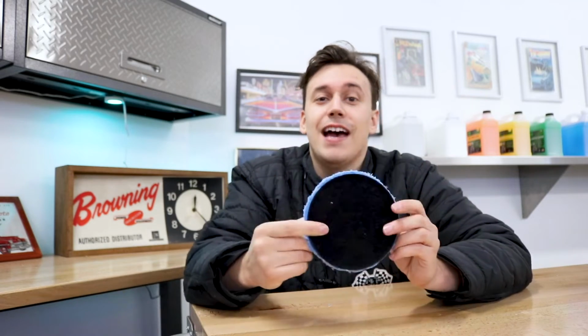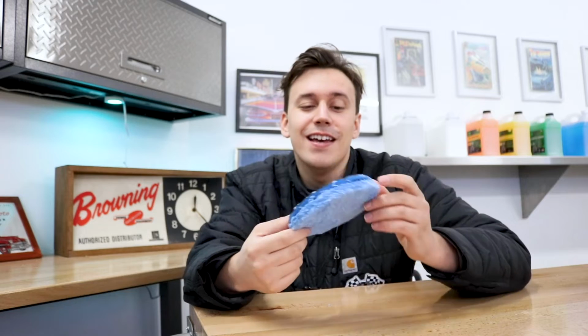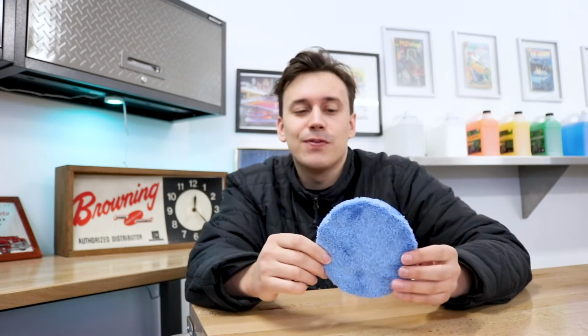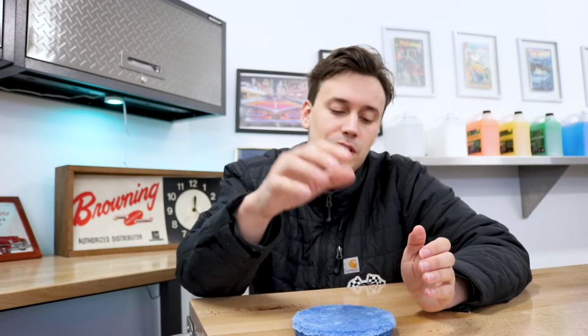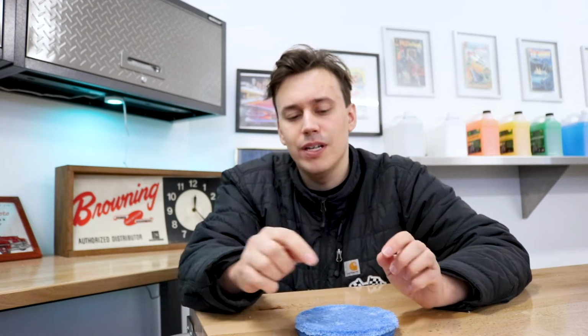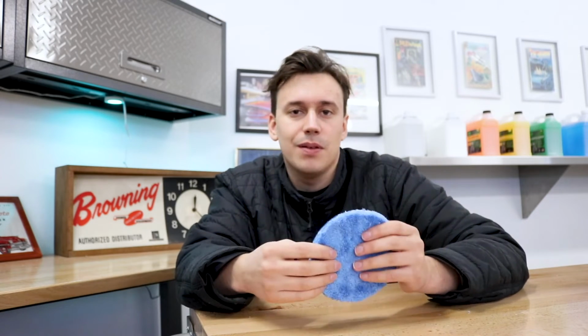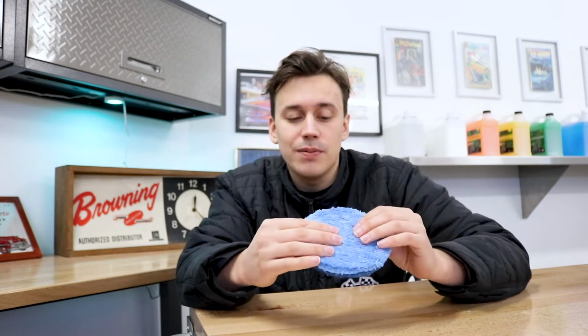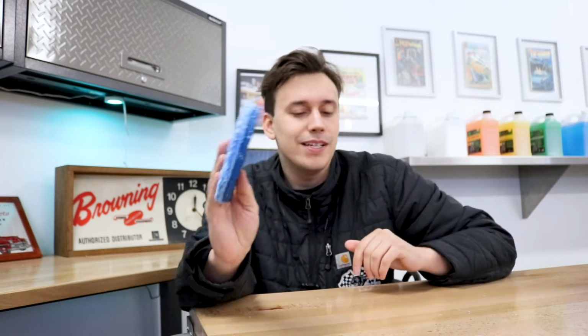Just like that, it actually worked, and it kind of somewhat looks like something that might actually exist in reality, possibly the world's first Eagle Edgeless Microfiber polishing pad. Now, the reason we went with the spray glue is because if we went with a liquid glue and it started to harden in certain areas, there could be high points which would negatively affect the paint in a pretty serious way. This way, there's nothing, it's super soft all the way throughout,